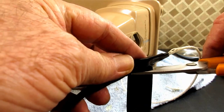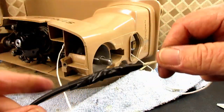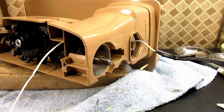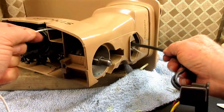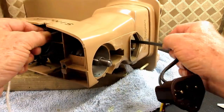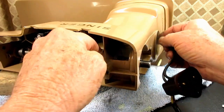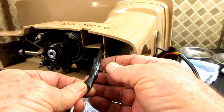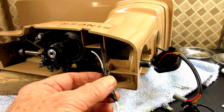If you can just stick the wire up in there and push it through with a stick or however you want to do it. It does always seem to like to hang up, but there it goes. Then let me take this tape and string off and I'll show you how to put the light lead back in and splice them together with new wire connectors. To put our new wire connectors on here, we're going to have to strip off the insulation — about three-eighths to less than a half inch is about right.